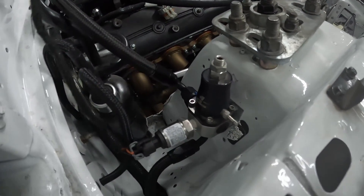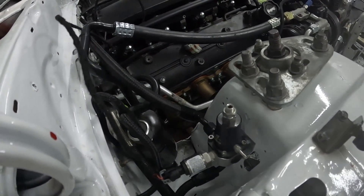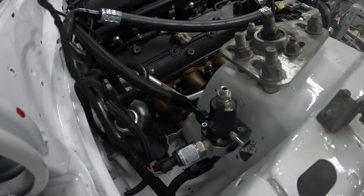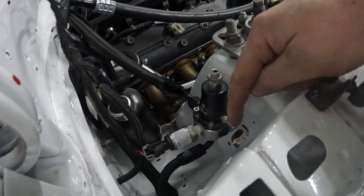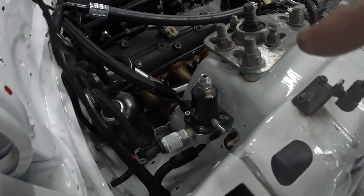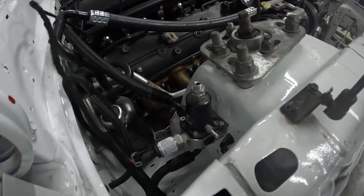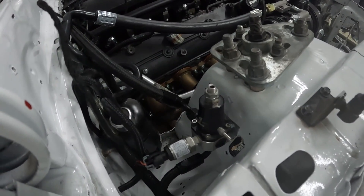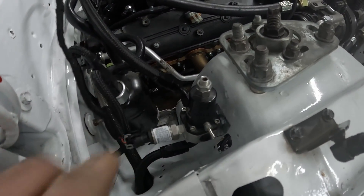This is my regulator — it's a pretty standard unit. This Aeromotive regulator is a good quality unit; it's got a boost reference port on it. This line gets boost pressure from the intake manifold, and as boost pressure goes up, fuel pressure goes up — because the injector is seeing higher pressure. It should go up essentially one psi of fuel pressure per one psi of boost. This one is good to about 75 psi, and I've also got my Holley fuel pressure sender in there going to the computer.